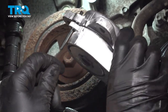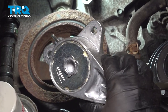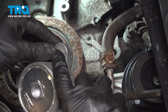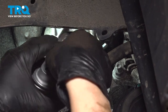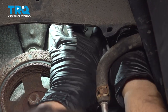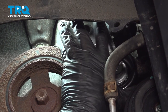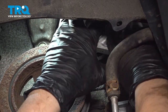The new tensioner will have this pin in it — this is so that you can put the belt on easily, so that's what that's for. I'm going to leave this in for later. I'm going to put the right-hand bolt in there so it can be ready to be threaded in once this all lines up. Bring it in the same way that it came out. Once the bolt falls into place, be ready to thread it on so it can kind of stay in place.